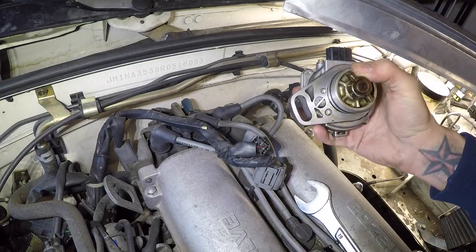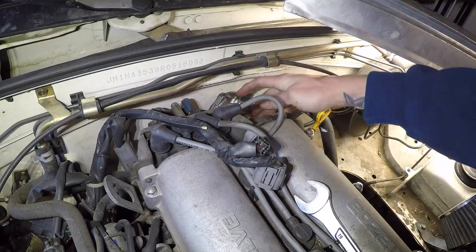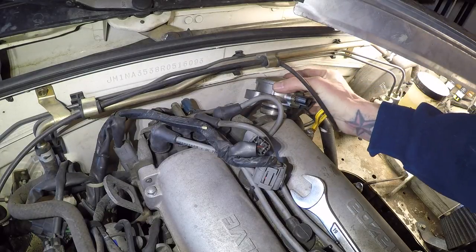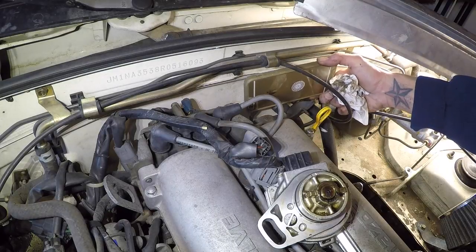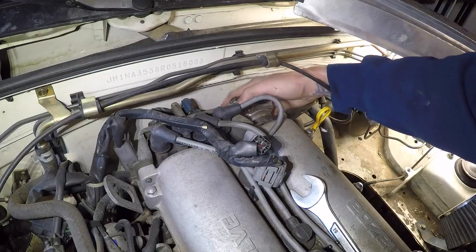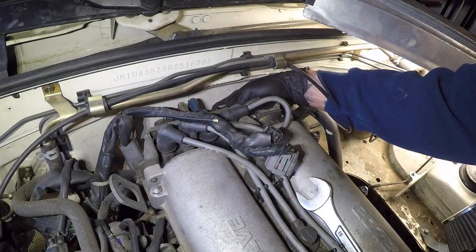So now with our pin pretty much in the spot we wanted it to be in, we're gonna move it right back in the way we took it out, making sure that that pin stays where it was supposed to be and kind of feel where the top is. Just kind of wiggle it in. That O-ring is gonna be tight. Now there is a possibility when you're pulling it out that you accidentally spin that post around. So you definitely want to use a mirror or even your cell phone on video and take a quick video of the backside so that you can see exactly which post is pointed where. And now based on the video, I can kind of see that it looks like this actually spun around on me. So this one needs to be at the top, and then hopefully with the right post in the right place. So a little bit of oil on the O-ring definitely does the trick. It does take a little bit of convincing.